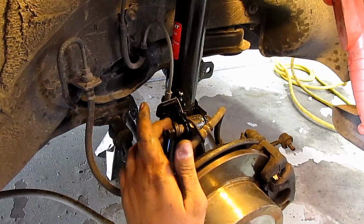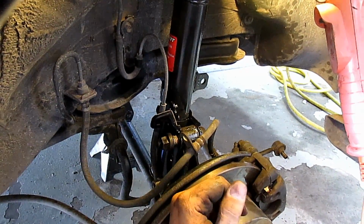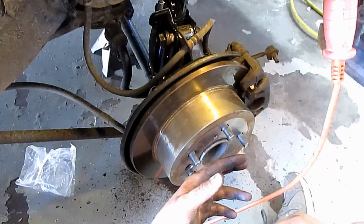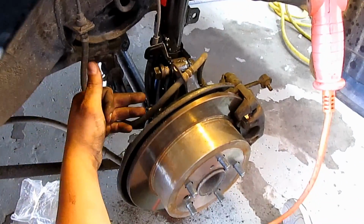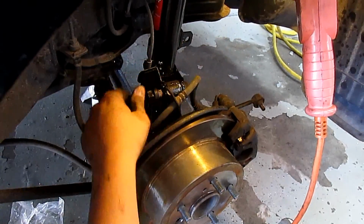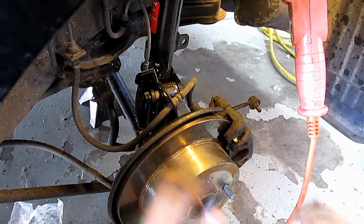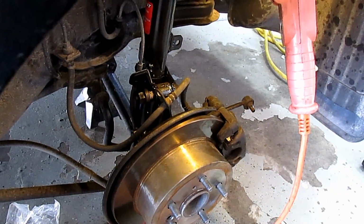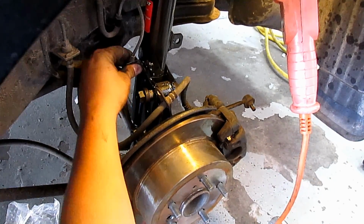Once you get the bolts in, which is a little difficult for me on this side, I had to jack up this spindle. I sort of put the bottom one in from this side halfway, then I got the top locked in, and then I pulled the bottom one out and it slipped in the bottom easy. Because when you let the pressure go, this thing wants to flop this way. So yeah, just take your time, try not to get pissed off.